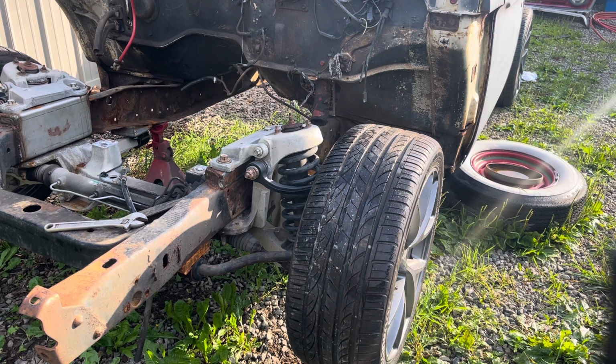All right, well, we'll put you on the time-lapse video, and I'll try to make sure I get some pretty decent shots of what's going on. Basically, it should be just plug and play on these. Pull the bottom bolt out and the three top bolts that mount the thing. Hopefully we can get it out of there. If I remember right, I think you have to take the top A arm out, which is just pulling the two bolts out. We've already had them out changing the arms out. That should be pretty simple. So we're going to get at it.